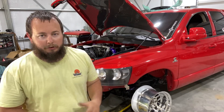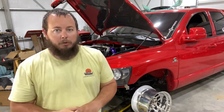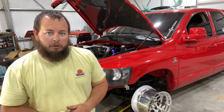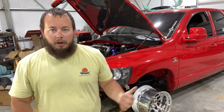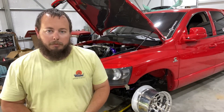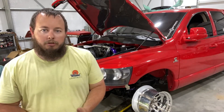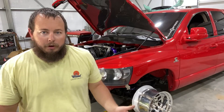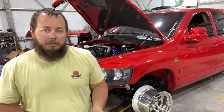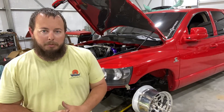They'll get packaged back up and put on the shelf. I may eventually throw them on this truck for the time being, just to try more of a strip-based tire as opposed to a street radial like I've been running with those ET Streets. The ultimate goal was to put a set of 28x10.5s on these wheels and run them on the regular cab so that I could run small tire at our local track. I'm still going to do some more talking to people about that, but if it looks like I'm going to have too big of an issue with that small of a tire, Mickey Thompson has an ET Street R — it's a 315, which equals like a 30-inch tall tire, a really good radial. I used to run them on the '06 and never had any issues.